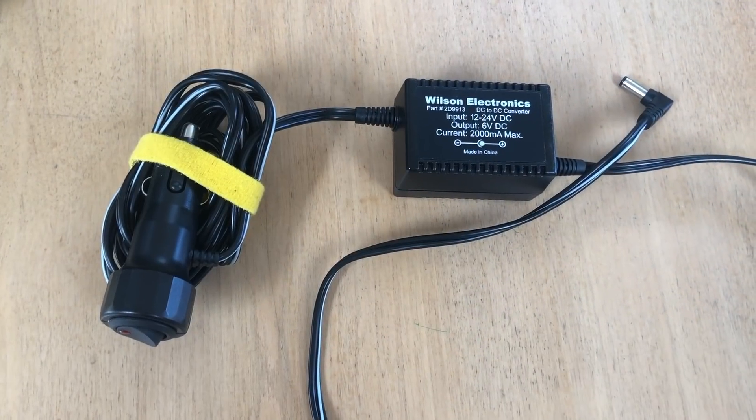The reason Doug did it is because he charges his WeBoost that way. He plugs his WeBoost — which comes with a cigarette-style plug — into his ottoman area in his PleasureWay Ascent. So depending on where your plugs are in your vehicle, that might determine whether you want to do something like this. I had already ordered one that would go into AC current, so we have to have the inverter on for that. The reason you might not want to run it off the inverter is because the inverter uses energy itself and is only about 85 to 90 percent efficient. So running your WeBoost off of the 12-volt battery is much more energy efficient than running it off AC current.